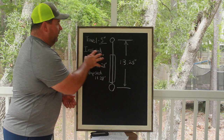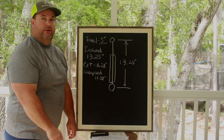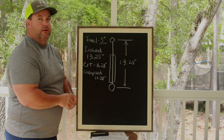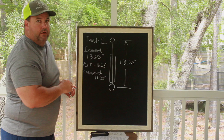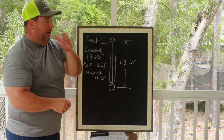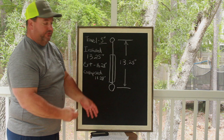The second thing I'm going to ask you is, if you have a good installed height, how much spring compression do you have? Let's say you have a 12-inch free-height spring. When you put it on your car, set the ride height, and the car is set, I'm looking on the rear for 25 to 30 percent compression. I don't want that spring so stiff it doesn't compress at all, and I don't want a spring that's 50 percent or more collapsed. So 12 inches times 0.75 gives me a target of a 9-inch spring height with the car at ride height.